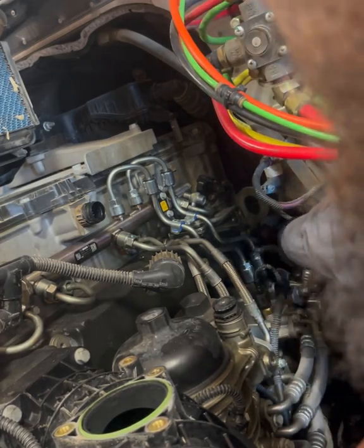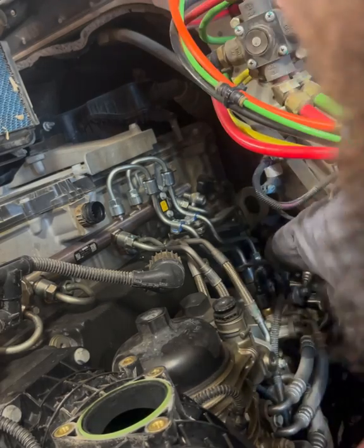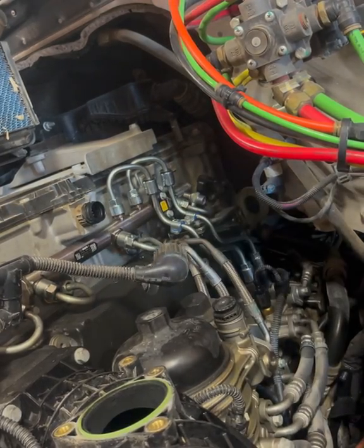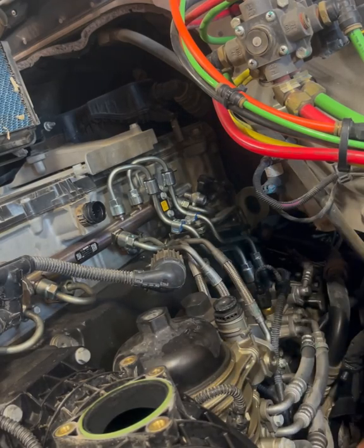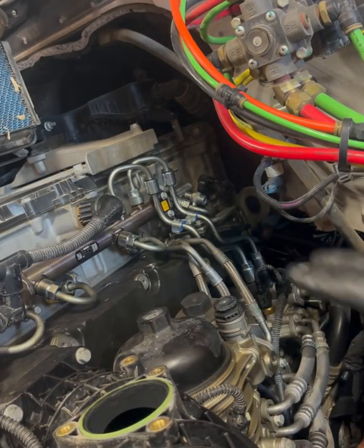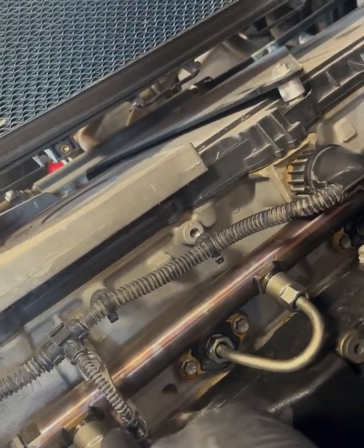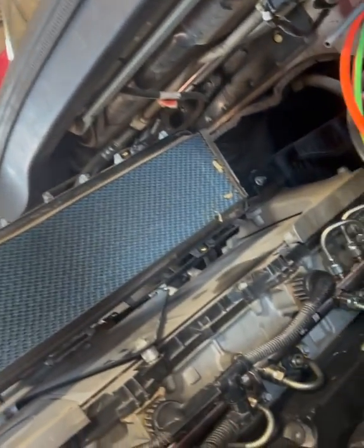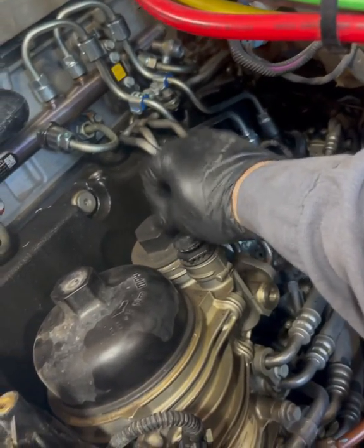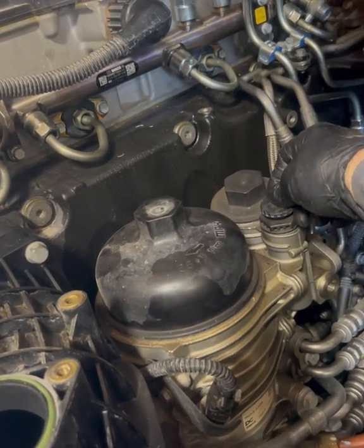There's no music in the background right now — YouTube always cuts out my audio when I've got music going on. Anyway, I'm going to torque everything down and continue with the harness. After that, the only thing left is the sensor and the filter cover. Once that's done, I can prime the system using this hand primer here — make sure it's full of fuel and just pump it about 200 times. It might still be a little hesitant to start, but it should catch on.